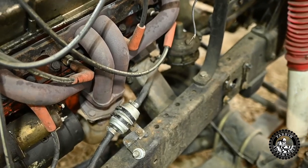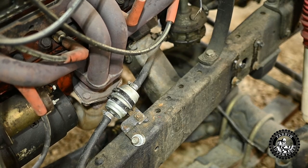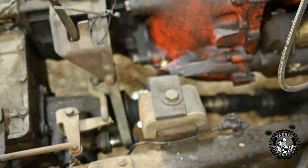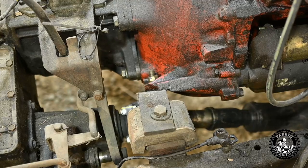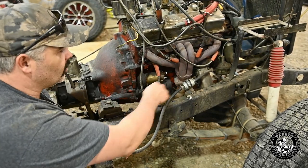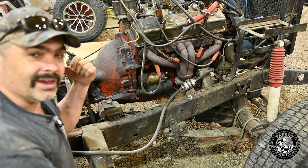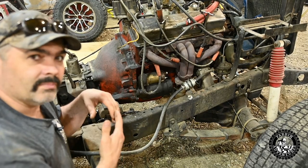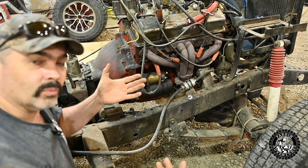What we're looking at here is the front engine mount, and it's pretty crudely done. I think the engine mount itself will be fine to reuse, but the way it's welded to the frame is kind of hack and whack. And going back here, he's got the rear of the engine mounted off the bell housing with a really crude mount, and that's just not going to fly. I'll cut all this stuff off, pick this engine, move it ahead a little bit, tack it for mocking up purposes, and then make a rear crossmember. I'm going to call my buddy in Hinton and get a measurement from the back of the engine to where the mount is on an Atlas transfer case, so I can make up some crossmembers.